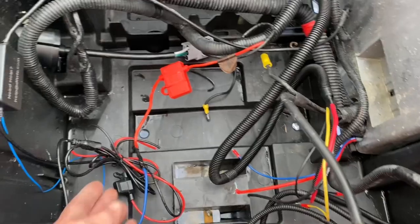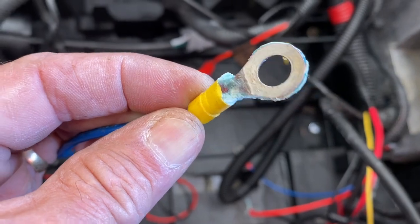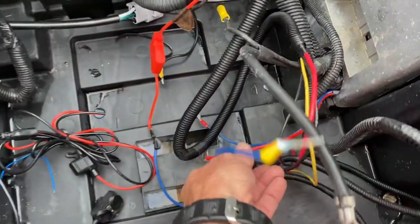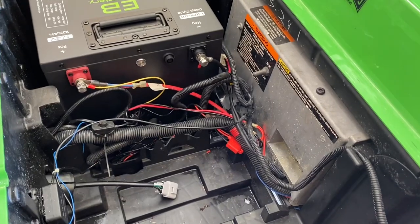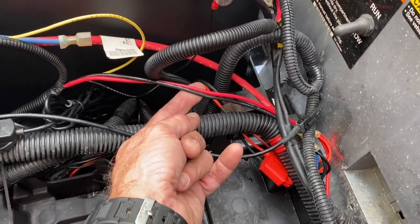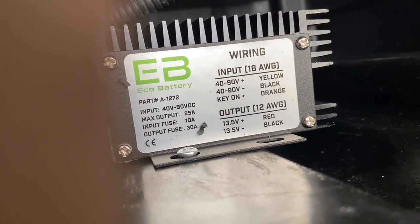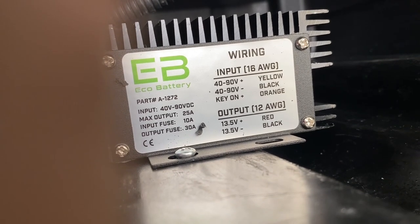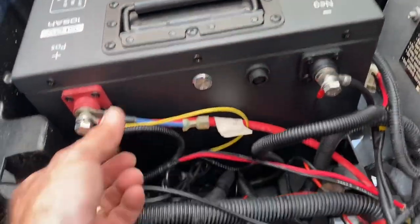This customer has some underglow lights — I've already cut the connectors off. It also has headlights. You can see a little bit of corrosion from the lead acid batteries, but that's not going to happen again. Now while you've got it apart, now's the time to cut those connectors off and put new ones on. I've got my power accessories wired in to my red and black output — that's going to be about 13.5 volts output, actually written on the top of the voltage reducer. You've got the 40-to-90-volt-plus on yellow and black, and then an orange wire for the key — we're going to jump on that next.